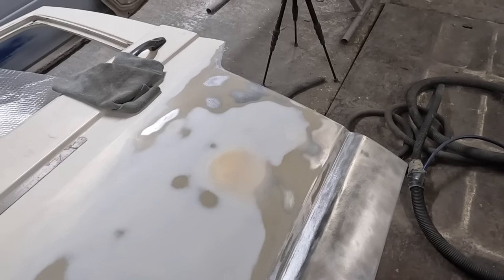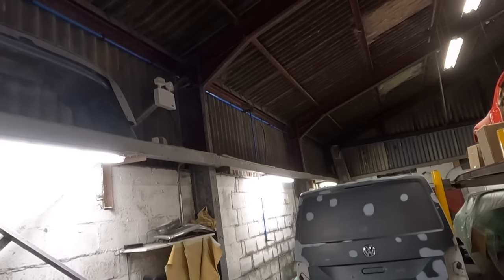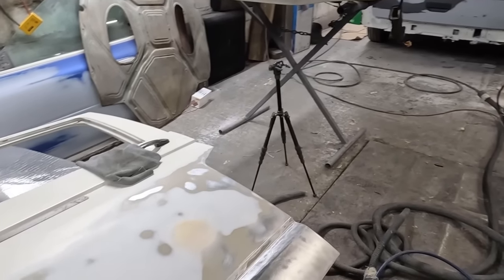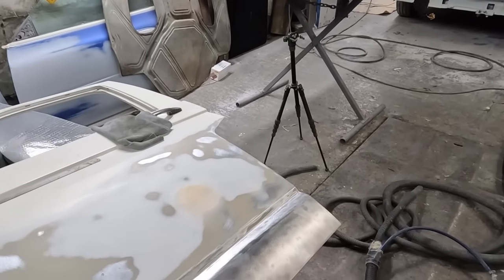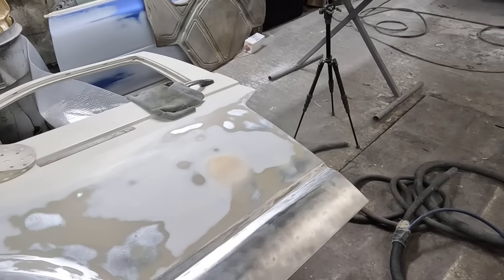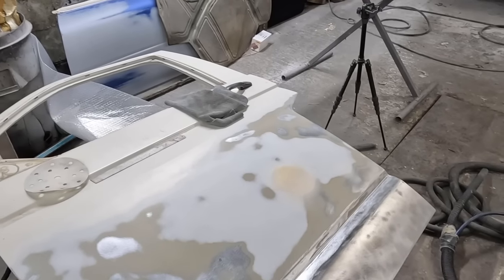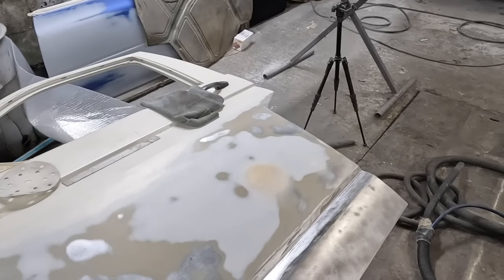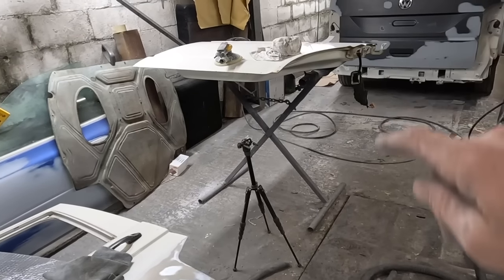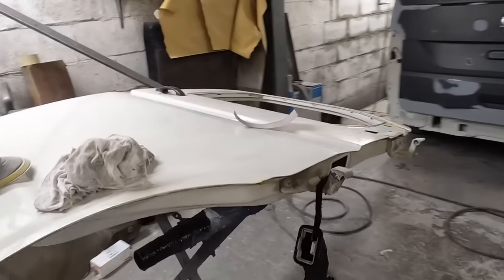Anyway, it's 10 o'clock and it's still raining - it's rained from half seven when I got up right through to now. No good for the mental positiveness but we still must crack on. I'm going to leave this here. Tomorrow we're going to tackle these dents on the swage line and I need to finish the rest of this door - the rust runs slightly under the lip so I need to bare metal those, zinc prime them.